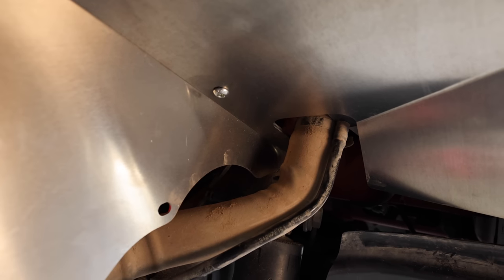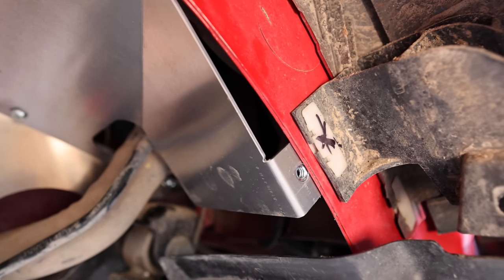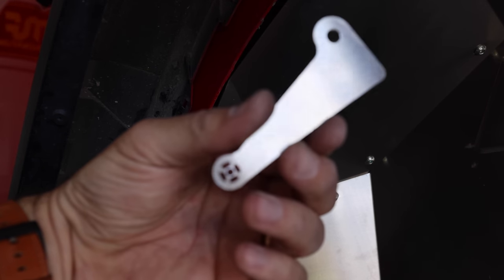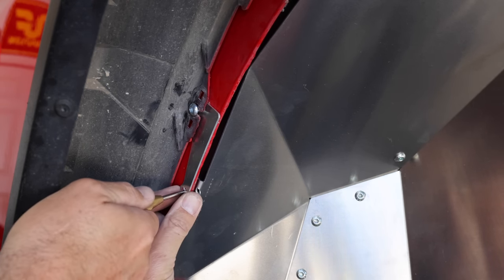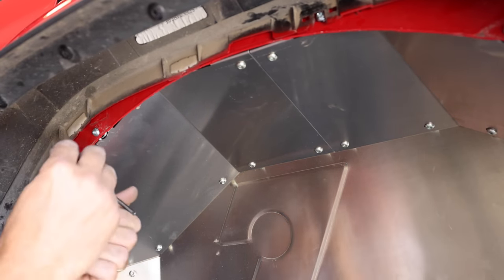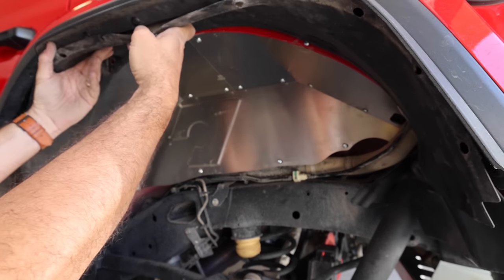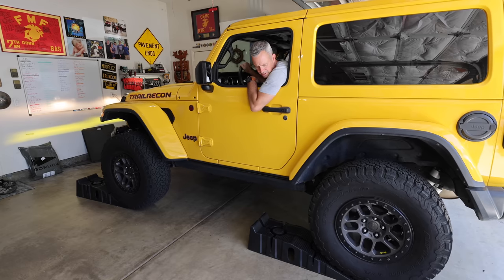Make sure you've got good clearance before you try to stuff it in behind the fuel filler neck — we did pull that back just a little bit to make some room. I marked the three clips that are going to be removed, and once those are removed you have access to install bolts there. There's also a provided template that lets you bolt it up to one of the holes and provides a bullseye target for where you're going to drill. Once the hole is drilled, you've got several bolts to install, and then back to work with the exacto knife trimming the plastic inner fender liner. We are done — well, except for the other fender, which we don't have enough clips to reinstall. Fingers crossed Regina is able to get some.